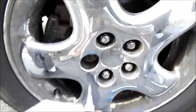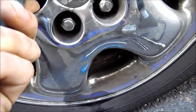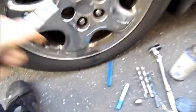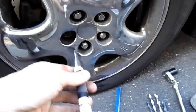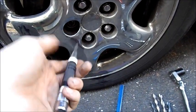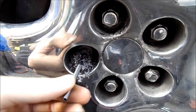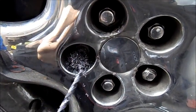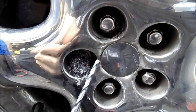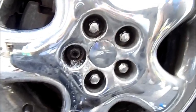Before I forget — get yourself one of these auto punches, line it right up in the center, and spike your hole. I'm not going to demonstrate it on camera because I need both hands. About 20 minutes in and I'm about half the length of the drill bit deep, so I think I'm gonna step it up to the next size now and see what happens.